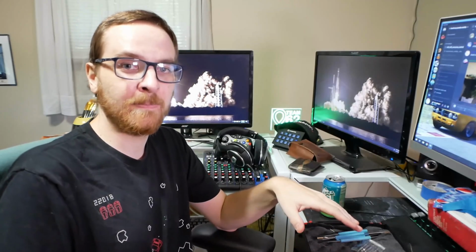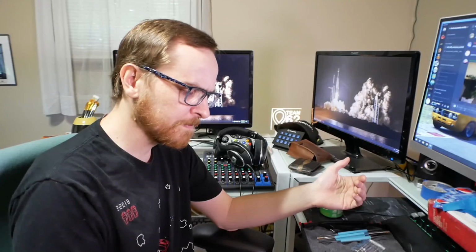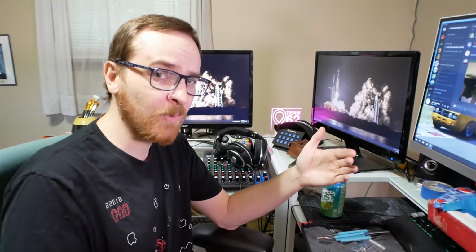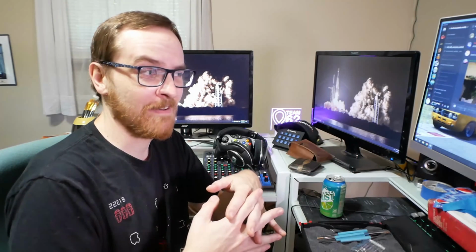My best theory is that the EDIS system handled all of the timing to a degree. I know there was an output from the EDIS to the ECU. It must have just been using that in some way or another to control timing. I have really no idea. Neither of us do. And that's why we were getting no engine speed during cranking, and we obviously were not getting any ignition, because the ECU had no idea what was going on with the engine.